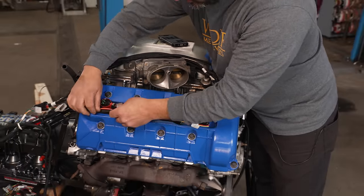When we got our Lincoln, I paid $1,200 for this thing. It was pretty clapped out. These cars come with a notorious air leveling suspension system, and pretty much everyone deletes them that wants to keep them reliable and not spend $8,000 to replace all that stuff. Our car already had it deleted, but the other brand of delete kit actually had some broken coils in it. So we reached out to our guys at Dorman and they sent us their kit. Again, it's just taking what's like an air spring and converting it to a proper coilover. And then you don't have any more problems.